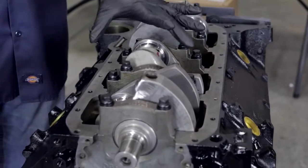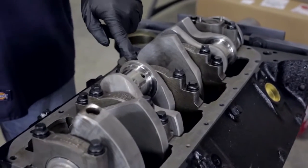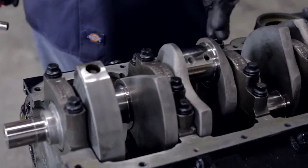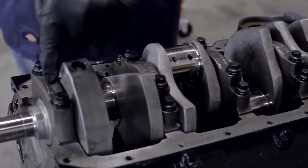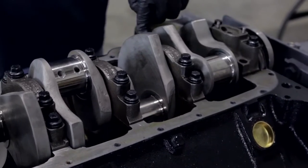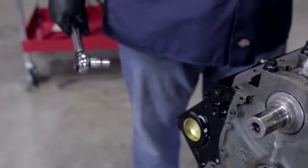On ours we start in the center and work outward. For this four-bolt main setup, the sequence goes: third main cap (1, 2), fourth main cap (3, 4), second main cap (5, 6), back (7, 8), front (9, 10), then back to third main cap (11, 12), fourth (13, 14), second (15, 16). We do that down to 35 foot-pounds, then come back at 50, then finish at 70. For the four-bolt main, we do the center bolts at 70 pounds and the outer bolts at 65 — because overtorquing the outers can bow the cap and affect engine performance.